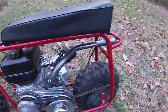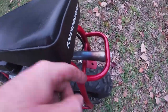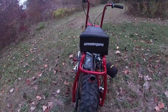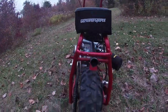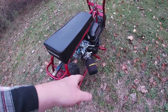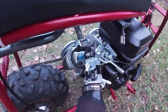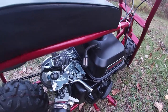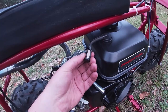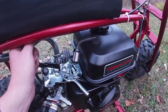It's got the center exit exhaust pipe — I sprayed some WD-40 on it to give it a little color and it changed colors right at the perfect spot. Got the center exit and everything from Go Power Sports. It's got a hydraulic clutch, stage one, a K&N style filter, and it's jetted. I also have the valve cover vent and the gas vent, though I've been having some issues with these paper-thin gas vents — if they get wet they don't let air circulate through the gas tank and I've been having fuel cut issues.